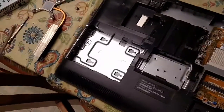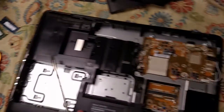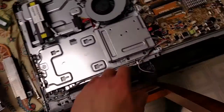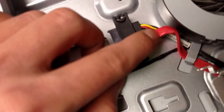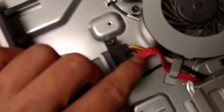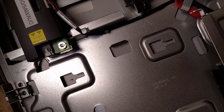I'm gonna have to disassemble the rest of this, but no point in filming it — there's just a bunch of screws all over the place. I'll link instructions in case you can't figure it out. Now we have a nice disassembled system, and all that's left to take out is the motherboard. That SATA cable is cracked — I guess from the heat. That's one of the many reasons why I don't like all-in-ones: they get way too hot.